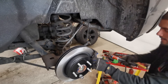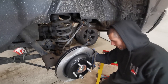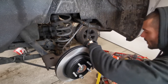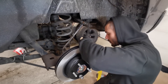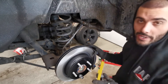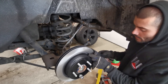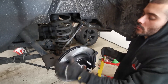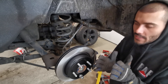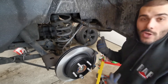Make sure the pad clears and goes on the inside of the shim — and you're good to go. The other pad is the same on the inside side. You kind of have to do them at the same time because there are tabs that the caliper bolts engage. Now I'm not using the hammer to bang these pads in — you never want to do that. You always want them to fall in so they can float nicely. What that means is when you apply the brake and the pads meet the rotor, that's great — that's what stops you. But when you release, they can't be stuck hard against it. They're going to be virtually touching, but you want them to have the ability to retract a fraction of a millimeter so they're not dragging and causing premature wear.